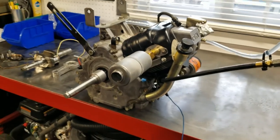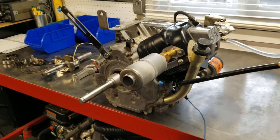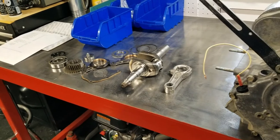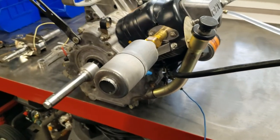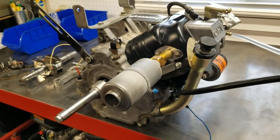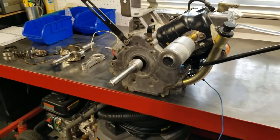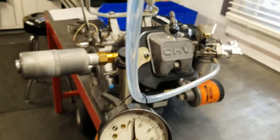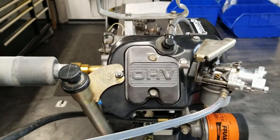If we've got a perfect oil pump we can shim the spring and create a little more oil pressure — not that we need it, but it's possible. If the oil pump is worn, or in this case completely destroyed because of the previous installation, you're adding insult to injury by shimming the oil pressure relief spring. You're basically preventing the engine from priming the oil pump, because our theoretical inlet condition isn't met — the oil isn't flooding the intake of the pump; it's slightly below, so we're creating a little negative pressure to pull it up.